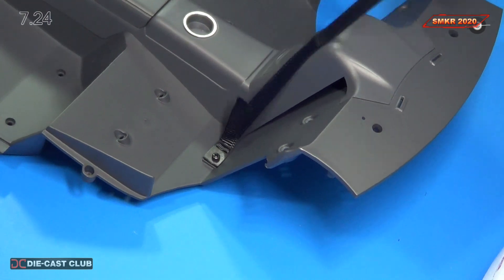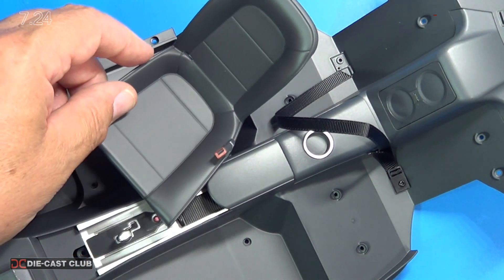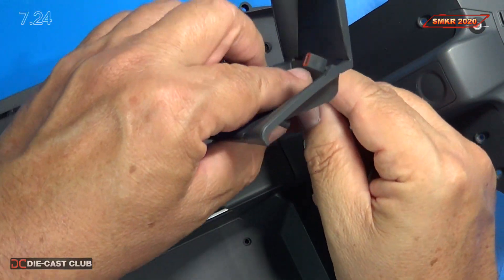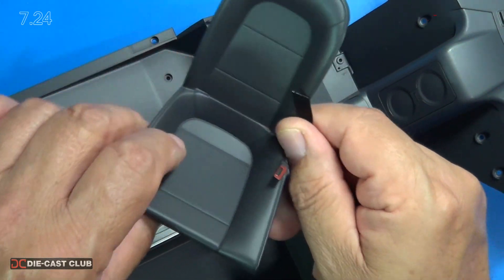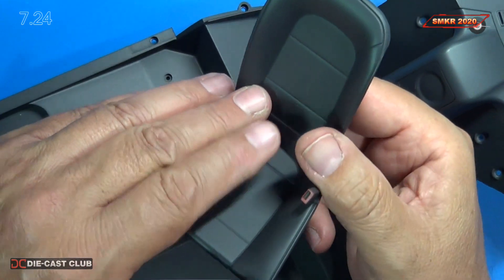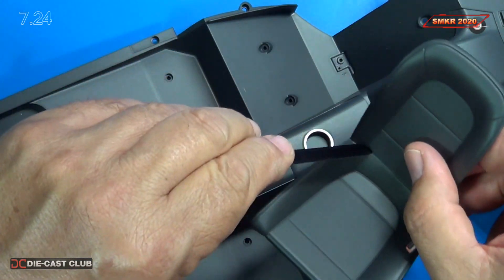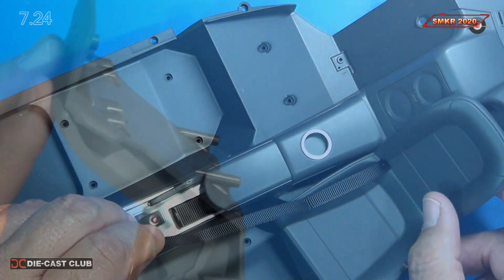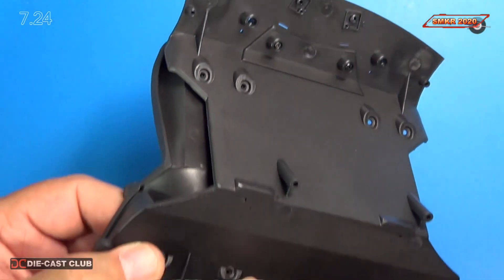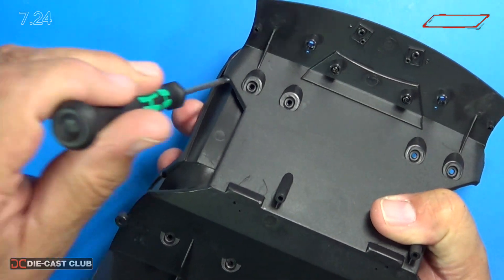Nice and tight, and that's what the seat belt looks like. The next step is we feed our seat belt through the seat. There's a notch there — it's going to go through. We'll just feed it through. It's also notched in on the back, so there are two mounting points. So we're going to put two screws in here and two up there.